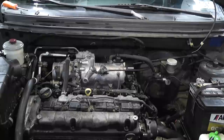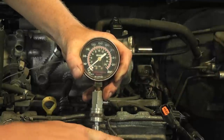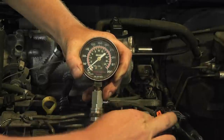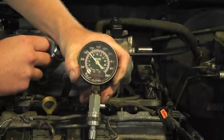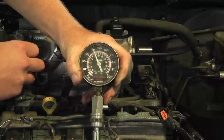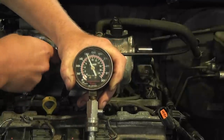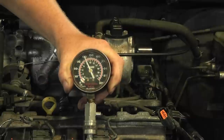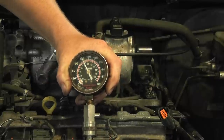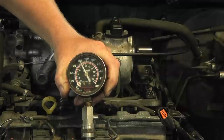So we're saying at this point we have good spark and good fuel. The next thing we're going to do is go after compression. I have a compression gauge installed into number four. I removed the spark plug, pulled the coil out, and unplugged the primary so we don't overload the coil. We have about 125 pounds of compression. You would think that would be enough for the engine to start. Something else to consider is cylinder wash — we've been cranking this thing for a while, and maybe putting a little bit of oil in the cylinder might bring that up.